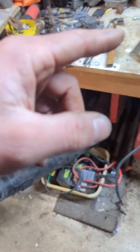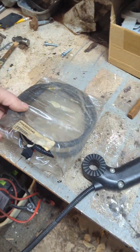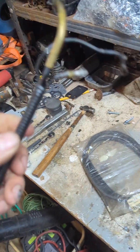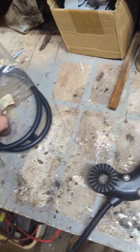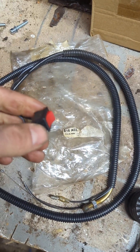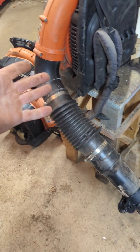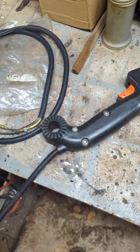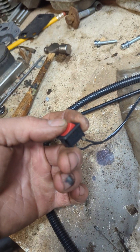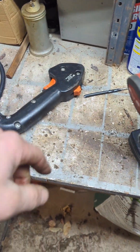So what we're doing today — I found one of these in my pile of engines and found a cable because this one's busted up, the end broke off. I'm going to show you how to change this. I don't usually recommend changing these, mainly because of what's going on inside the rocker — that switch in there usually gets worn out. So by the time you've got a year or two of commercial run time on these, the rocker is bad. Even if you put a new switch in, it'll only get it to rock three-quarters of the way — it won't click, it'll just stop right there and won't shut it off.